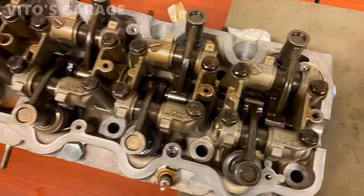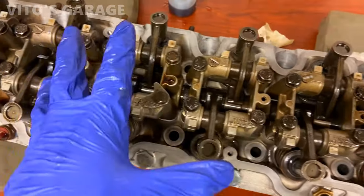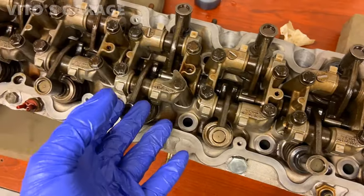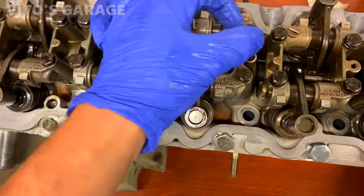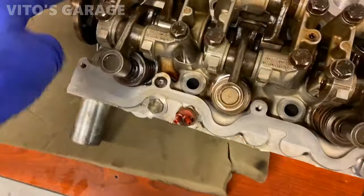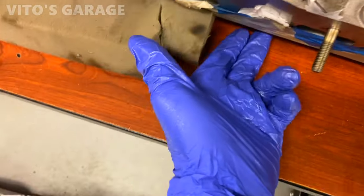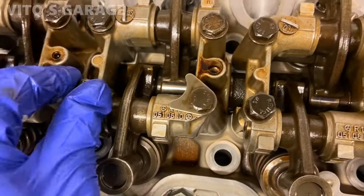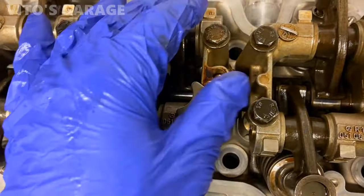All right, now I can go ahead and tighten this camshaft. The manual doesn't specify exactly the sequence of tightening, but I started each bolt by hand as much as possible. Also, this is top dead center, so make sure that you leave space for some of the valves that are gonna be opening once you tighten it. And then I'm just gonna go basically kind of like the head gasket sequence.